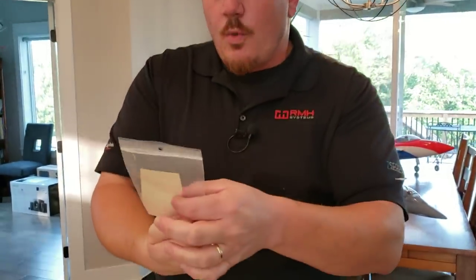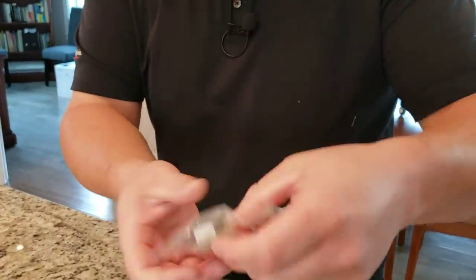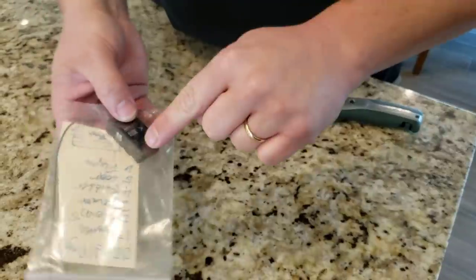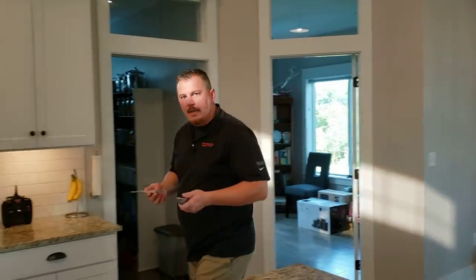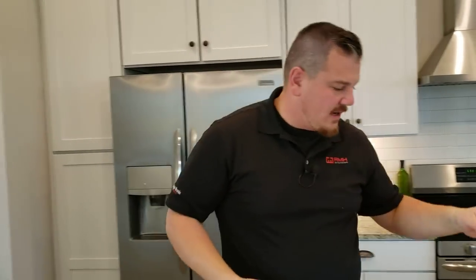So I usually just mark down, like I did on this, where things were plugged in. And then I plug them in and I put the orientation on my note. So it says to the front. Okay, so I just put those pins to the back of the plane, then toward the nose of the plane. And that tells me what direction it has to be facing to give me the right output on the control surfaces. But keep in mind, sometimes the servo is mounted with the output shaft up here, and then that spins a rudder. And then sometimes it's mounted like this and it spins the rudder. So you really don't know what direction the output shaft's gonna run.